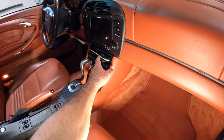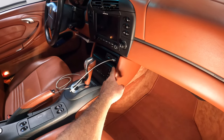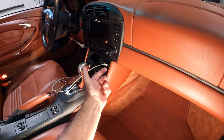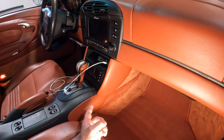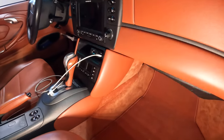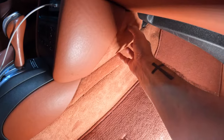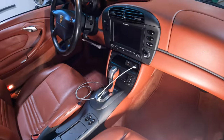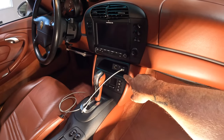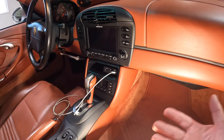So here we are in the car. I've got my multimedia box here with the cord that we're getting rid of right there in that center shelf. This is where that A1 product from Autobahn Engineering is going to replace all that. The next question is where do you put all the other stuff? We do have a cigarette lighter here, so I'm going to try to tap off the back of that to put the auxiliary cigarette lighter in so I can plug the MagSafe charger into that. I'm also going to take the wireless CarPlay adapter and try to put everything back underneath here. I'm going to have to take the radio out, unplug it, get it back through that hole, and plug it back in and stuff it down to the back — a little more work since I've already installed it.